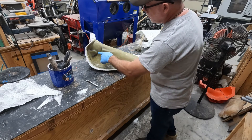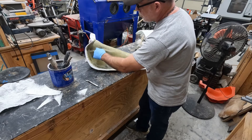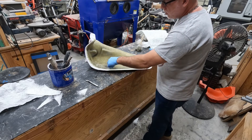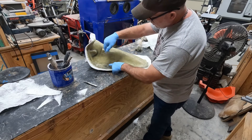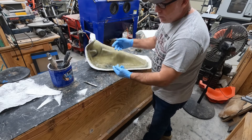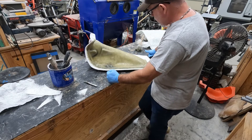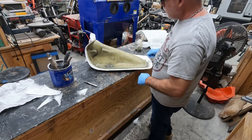Overall, working the air bubbles out of this section is generally fairly simple. It takes a little while when you're doing these harder bends — you can understand why I put the putty in there to help keep the bends to a minimal. The extra layer also helps because it's a much smaller patch, able to get the air bubbles out prior to putting the bigger sheets on. When I came down to here, it's harder to get these air bubbles out, so I use an old razor knife, poke a hole to the hard spot of the gel coat, work the air bubbles out through the hole, then finish closing it off once it's all sealed.